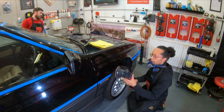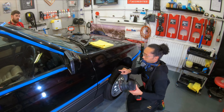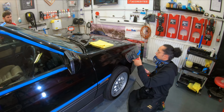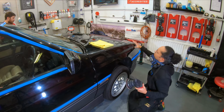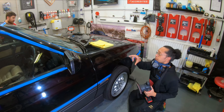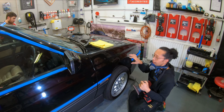I don't want to be doing that. I don't want to be going over here and I can see there's a gap down the middle. There's going to be a hot spot there. And more importantly, where you can see my mark, there's going to be a hot spot there. It's going to blow the paint off. So I'm going to attack this edge like this. Then I'll deal with this flat. Then I'll deal with this in here. This is relatively simple, watching the hard body line at the top. So I'm going to put it on time lapse, but you'll see how I attack this in the different angles. Really got to be careful on these sharp edges.